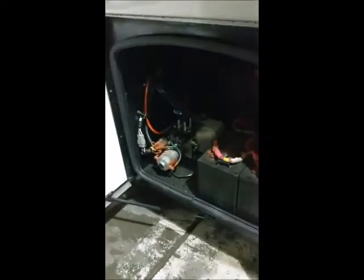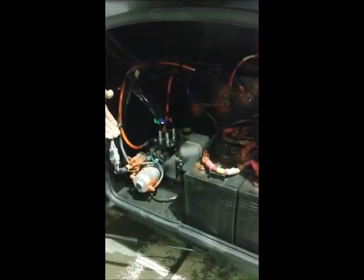Coming back to the next compartment door. This is your house battery station. You have 4 6-volt deep cycle batteries that are tied in parallel and in series. 2 batteries tied together make 12 volts. And then the other 2 batteries tied together make 12 volts, and that's how they are wired to your system. And then you also have your hydraulic reservoir and pump center.